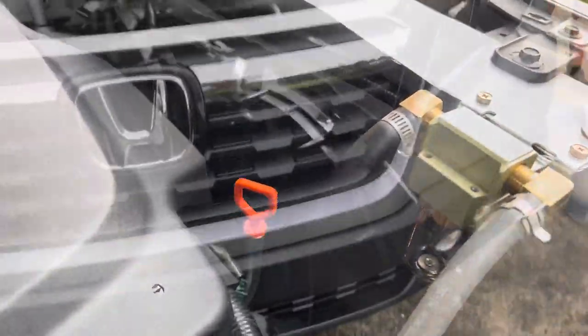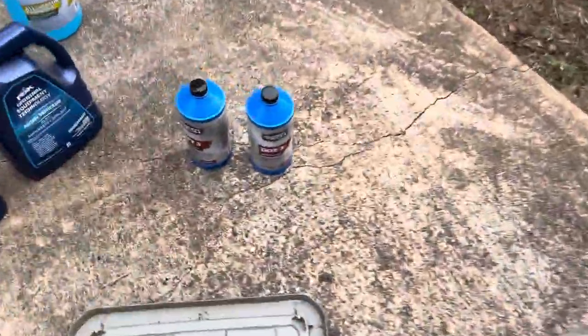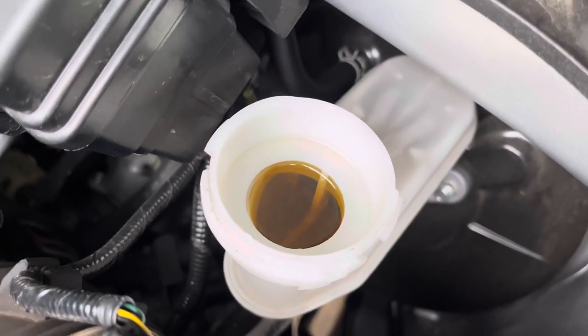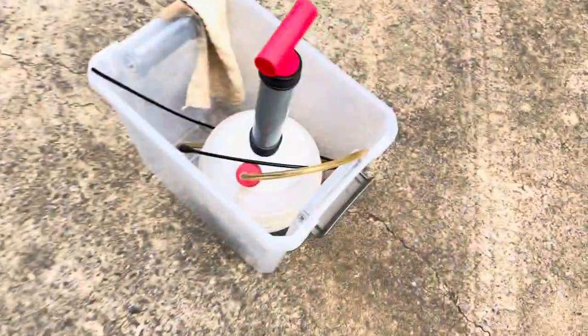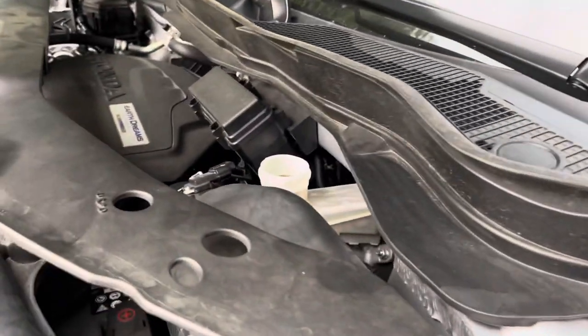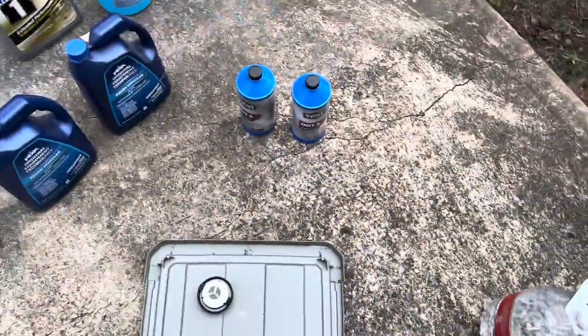While the engine's heating up and my distilled water is circulating for the third time, I'm going to go ahead and run two quarts of DOT 3 through. I'm gonna suck that old brown fluid dry using my pump first — it should be clear at least, it's not black like my Corvette was. I'm gonna suck that dry, fill it up with nice clean fluid, and then bleed all four brakes. The passenger rear will get bled first and the most because it's the longest line. We'll keep going until all the fluid is clear.